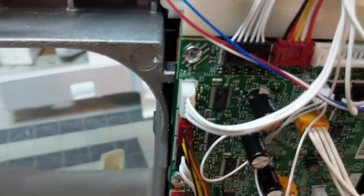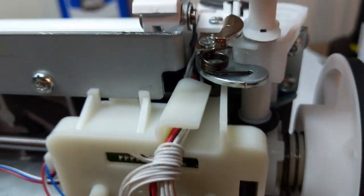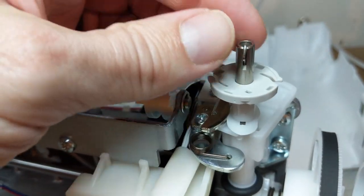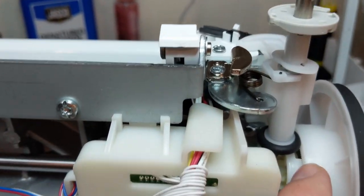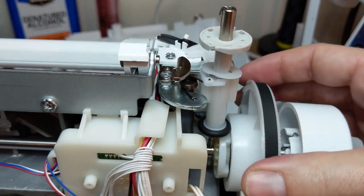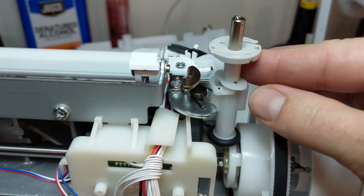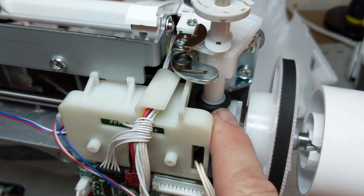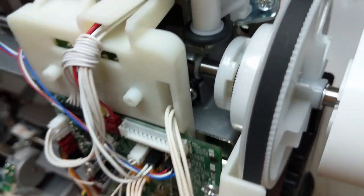Continuing our tour of the machine going up here — we already looked at the bushing behind here and our circuit board. Up here is your bobbin winder. When this thing goes over, it engages this little rubber tire — it's actually called a tire — and the motor will turn this because when your motor turns it, there's a clutch in there. Normally it doesn't turn it, but the motor turns this directly and that will wind your bobbin. Over time these tires do degrade; however, that time would be about 30 years, and this machine in particular will not be around 30 years from now — trust me, these electronics were not built to last 30 years.